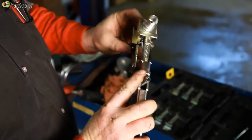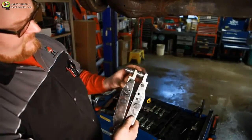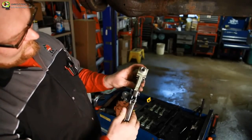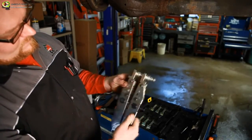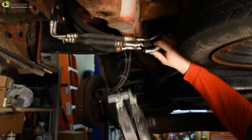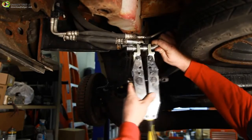Before proceeding to close the first side of the union, make sure that the union is held snugly between the jaws of the SWEDGE-LOKer tool and is aligned so the step portion of the collar fits correctly together with the steps on the jaw. Also see that the collar is oriented straight and will slide over the compression ring on the body. Insert the SWEDGE-LOKer tool with the SWEDGE-LOK union over one of the cut ends of the tubing, collar first, and then into the body, making sure the tubing is completely bottomed out in the body.